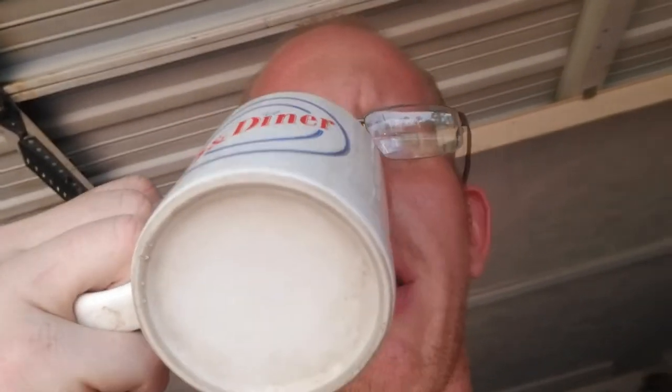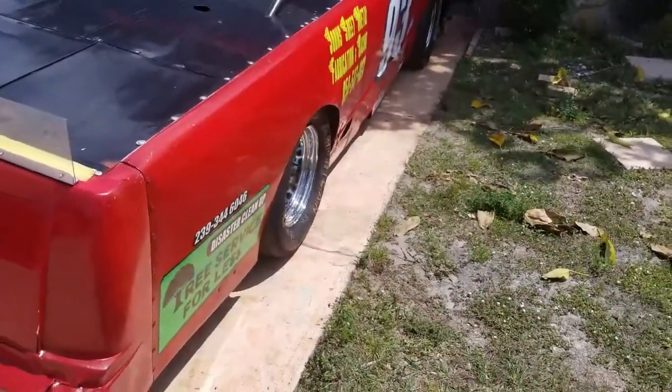So, got to practice for the truck next week. Got the truck pulled up front. We're basically going through the whole truck, checking the oil, checking the fluids, nut and bolt, changing rear shocks out on it, pulling all the jacker bolts out, cleaning them up, and putting anti-seize on them, put them back in there, so we can move those nice and easy at the track. Before they were a little rough. I like them to move easy because if I need to do an adjustment at the track, I don't have to put a breaker bar on it. So I'll show you that now.